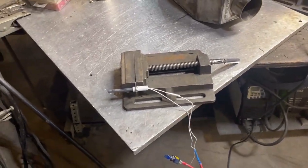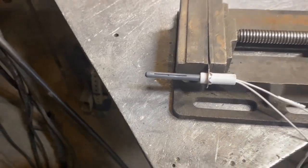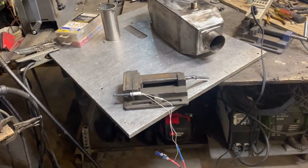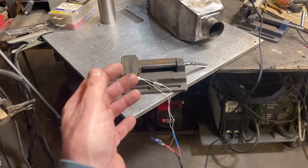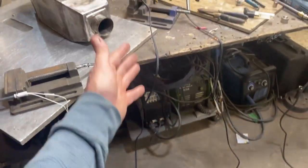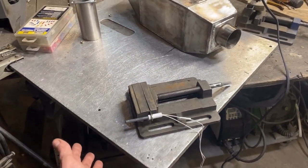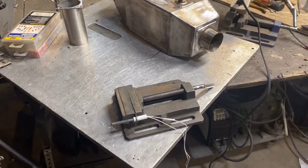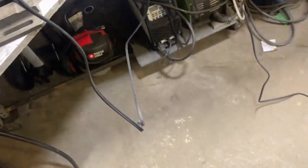What we have right here is the silicon nitride electric igniter — this is not the silicon carbide. The silicon carbide gives you a limited amount of ignitions; this is said to be more robust. The reason I like this over most is that it's just a straight-up 120-volt piece of equipment. You don't have to buy any extra electronics to run this; it doesn't need a high voltage system. High voltage is expensive — you've got to have high voltage wiring and all that.